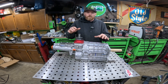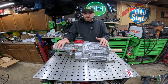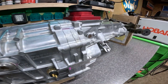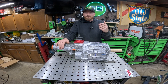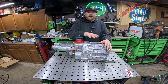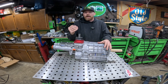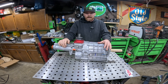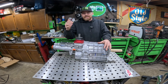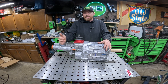It's really important that you consider a few things before you determine which overdrive transmission you want. You're going to want to know what size rear tire you're running, what your gear ratio is going to be, and what the intended function of the vehicle is. I know for my truck I'm eventually going to be doing some track-style racing — autocross or drag racing — so I went with a fairly aggressive rear gear, a 3.79. I needed to offset that steep gear ratio with the 0.68 overdrive, which will help bring down the RPMs when I'm cruising at 65, 70, 75 miles an hour.